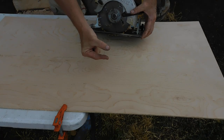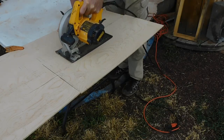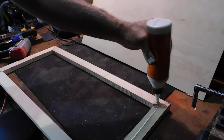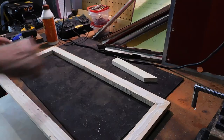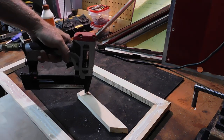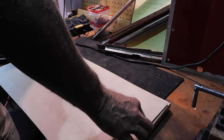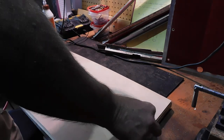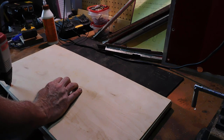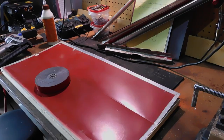A little safety tip: when you set up your skill saw, you only want the blade depth enough so that the tooth clears the product you're cutting. It always helps to have a spotter working around you to avoid running over cords, tables, clamps, or yourself. I'm testing my nail gun here to make sure the brads I'm using to secure this don't punch clean through or come up shy. I'm only going to use the bare minimum amount of fasteners to get a good bond to the glue.